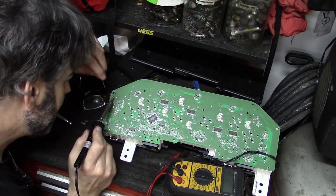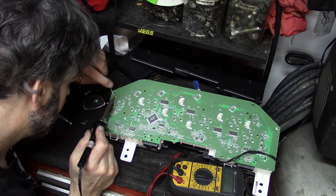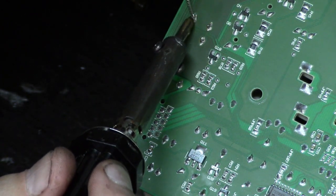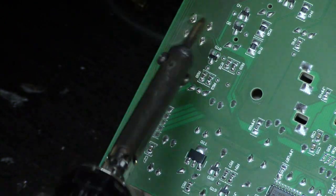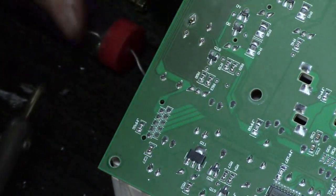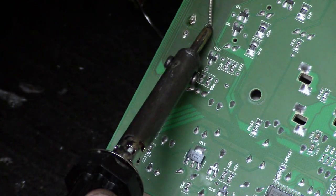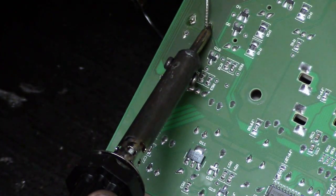The way I like to do this is to try to heat up the pin — the terminal — rather than trying to melt the solder over it. Get the terminal hot, and then when I touch the solder the terminal kind of melts it, so it draws it in. It takes a while to heat it up, but that's how I do it — not that I do this a lot. Now it's starting to melt the solder. Like that. And that is a much stronger connection — the pin's not wobbling at all.